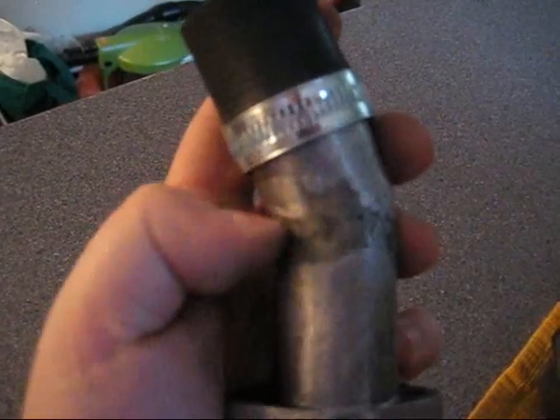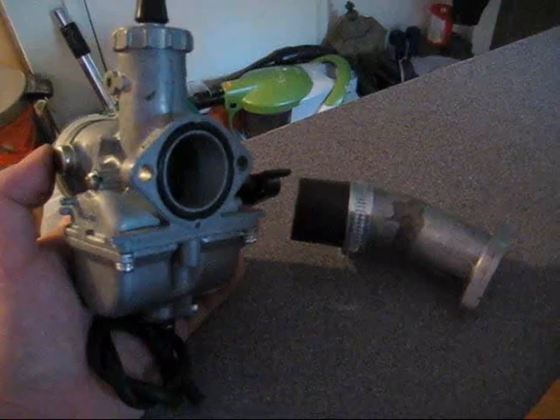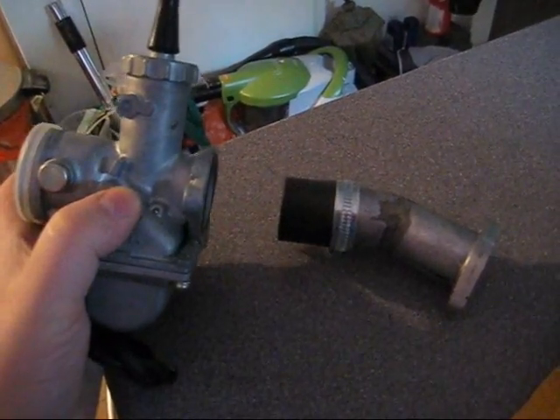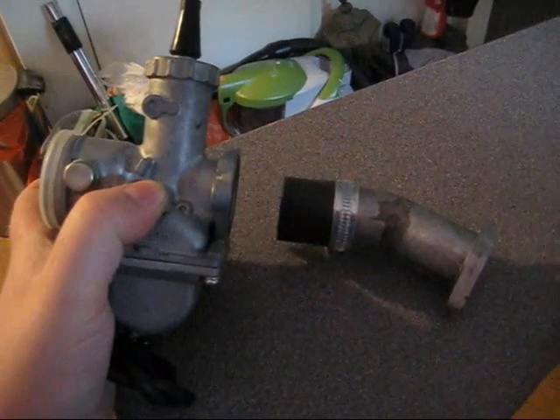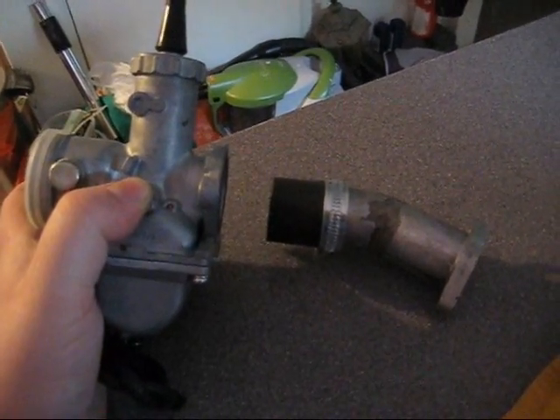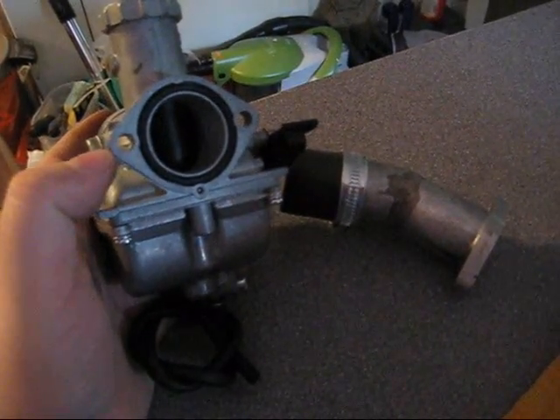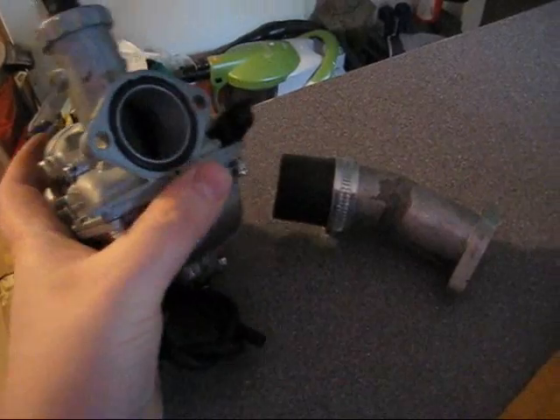I've got it all nicely ground out in there to get a nice smooth intake with no corners sticking out, with that internal angle smoothed out nicely. One of the jobs I still have left to do is to make the last section of the manifold to go between the rubber hose and the outlets of the carb, so I need to get a bit of flange going into a pipe to connect those.